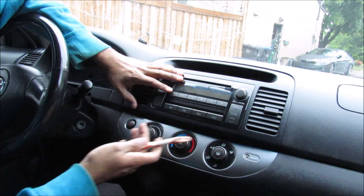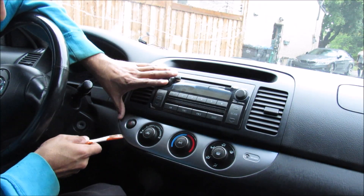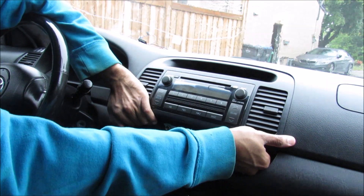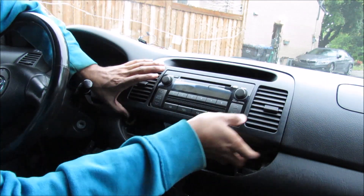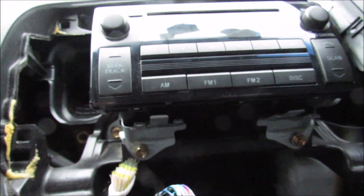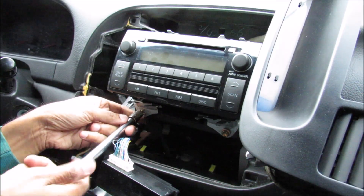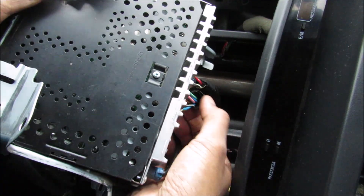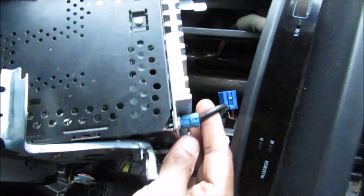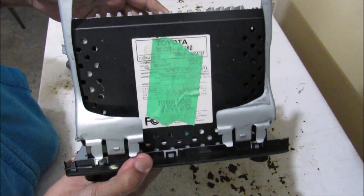The first thing we need to do is remove the radio from the dashboard. I'm going to use a tool to pry up this lower panel, and then reach in and pry up the HVAC vent panel. Looking at the bottom, there are four 10mm bolts to remove in order to get the radio out. There are two connectors at the back, plus a top one, and your FM/AM antenna wire.